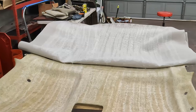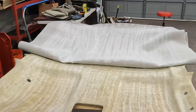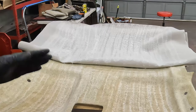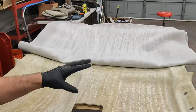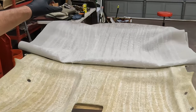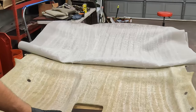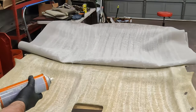I do think now that I've done it, and I said I was only gonna do one coat on the fabric, I should have done the fabric when I did the second coat here, because now that's gonna end up sitting for 10 minutes. And that's probably not ideal. So I may end up splashing some on just to see if it'll re-wet the glue. Real quick, advice: if you are only going to put one coat on the fabric, do that coat when you do your second coat here, so they have the same amount of dry time. So I'll mess that up.